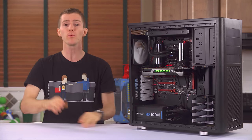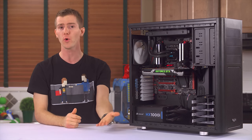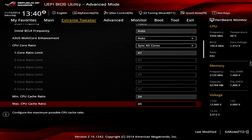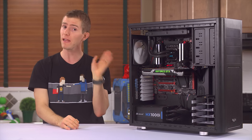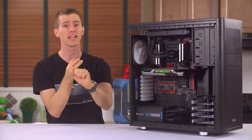One other thing you can fine-tune at this stage is the CPU cache ratio, or UNCORE. It frankly matters very little for performance compared to just increasing the CPU's raw frequency, but bringing your cache speed up closer to your CPU speed can help a little with some performance metrics. Once you change this, you may need to fine-tune CPU voltage and system agent voltage again.